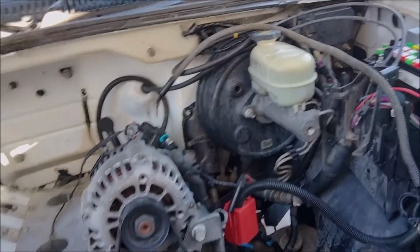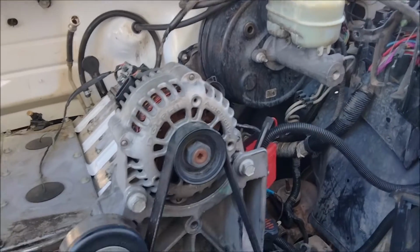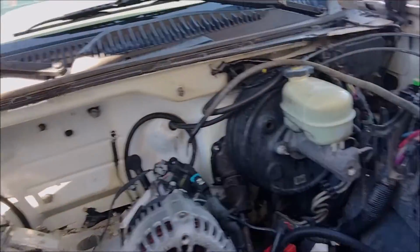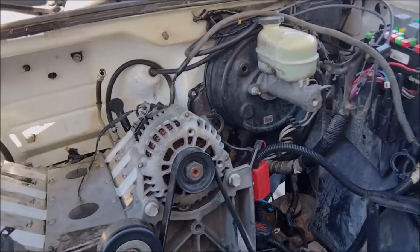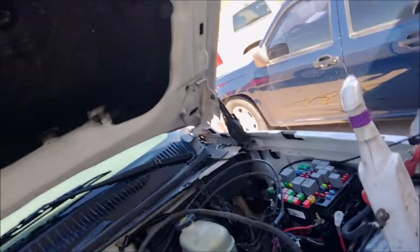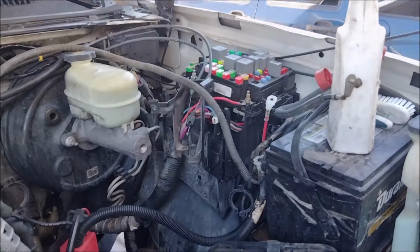So I always take the stock tune out first, save that, and then compare. I'll convert the injector data over for the return, which is the same number all the way through. I'll show you on the screen. It's pretty simple, but this is what I've done in the past, and I've had it not work. Take a V6 tune, and because there are drop-downs for the engine size, I convert the engine size and the number of cylinders. And I've had it where whatever's different in the V6 OS won't work. I've had it do some weird stuff on 8.1 swaps. So I always just convert to whatever the engine is. So much easier. I haven't had an issue with it since.